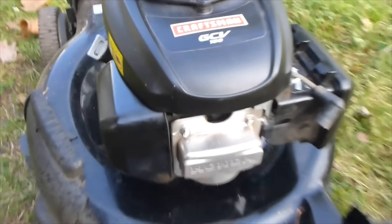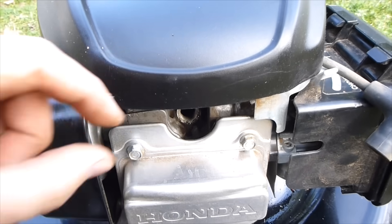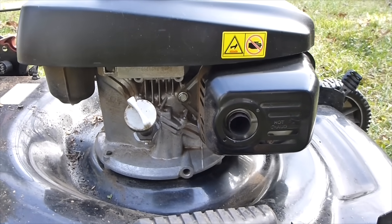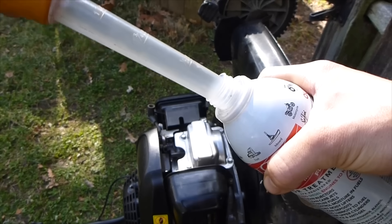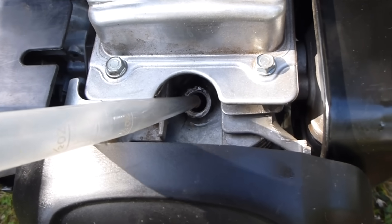So I'm going to try one more thing. The last thing I'm going to try is going through the spark plug hole and adding a little bit of seafoam to coat the whole top of the piston. You don't want to add too much because you could hydro-lock the engine, but just enough so the whole top of the piston is coated. Since the engine is sideways and the piston goes in and out that way, if I added seafoam to the cylinder it would only touch the very bottom of the piston. So I'm going to tilt the engine up so the seafoam actually sits on the piston head, and the carbon will soak just like you soak dishes. I'm going to be adding the seafoam using a turkey baster, getting a light coat on the cylinder head. You can see some of the carbon deposits that are already loosened up kind of moving around in the fluid. We'll let this sit for 5 to 10 minutes and then start the engine.